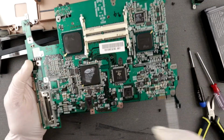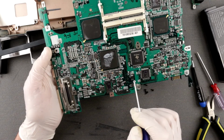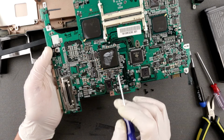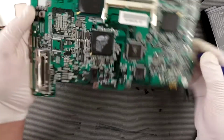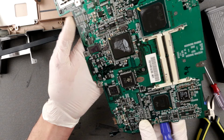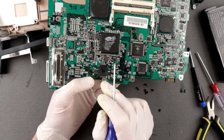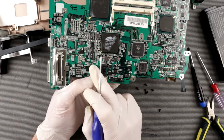Forget about these guys. So this is some glue logic. These guys, one, two, three, this one. Another TI element over here. Where did I see that? So anyways, these are some logic elements. So for example, HA14, right? I think this is like an inverting Schmitt trigger, if I'm not mistaken, this guy. Other, I don't remember. Alright, so this guy, no, never mind, this guy.